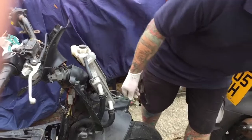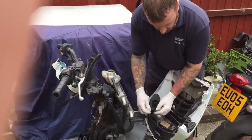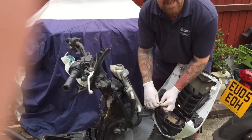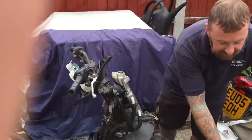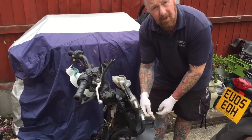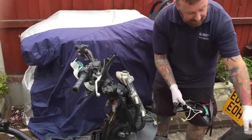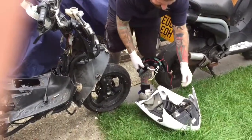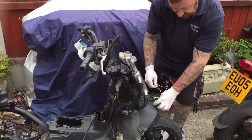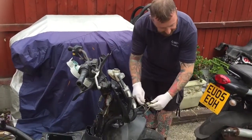Now the hard part — people say this connects into the back of this. What I would do is cut here, cut there, and cut there so you can still reconnect them for the MOT. Remember, this will not pass a legal MOT with the Evo lights — you have to retain the originals. What you're left with is this little junction box. Yellow is going to be high beam or low beam, white is going to be high beam or low beam, and green you must remember is earth. Connect through that connector so you can easily take it away. It's going to be live, live, negative, negative — touch black to the green and red to the yellow or white.